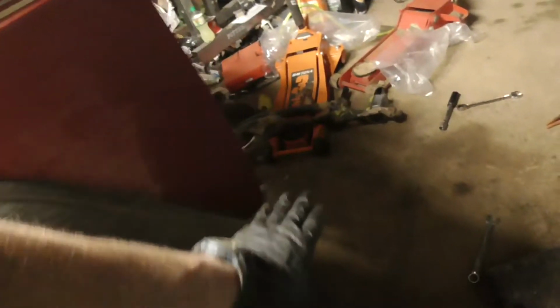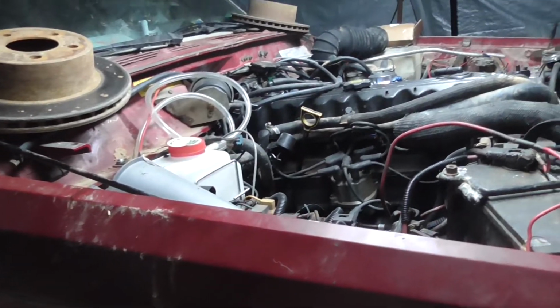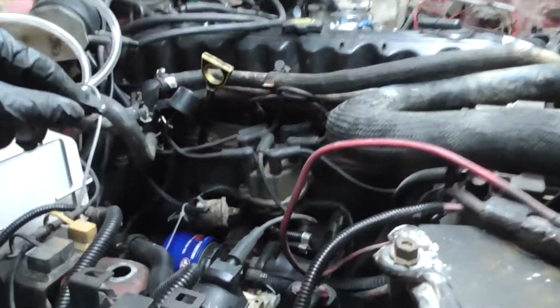Cut the front fender right here, because the later model, newer body style Jeeps don't have from like here down. My green Jeep from the factory doesn't have from here down, but '96 and back has this piece that goes forward. Cut that off right there, and then cut the fenders, and then cut and fold the rear so I have more flex. I think that's just about everything.